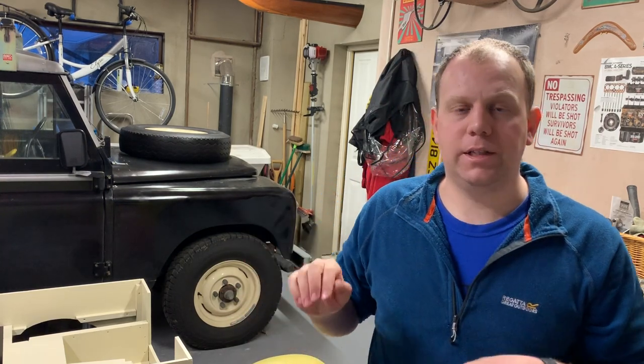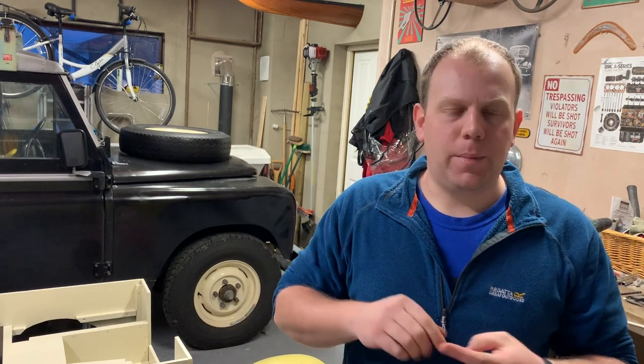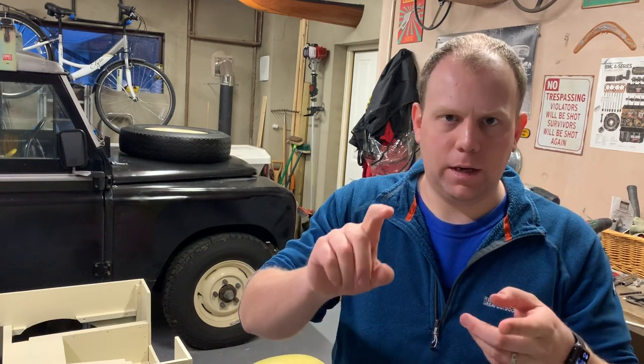The thumbnail in the last Toylander update probably gave you a bit of a hint as to what we've been doing, and we've made great progress on the lacquering of the bodywork. A lot of time has been spent preparing the bodywork for paint, undercoating it, PVA glue sealing it, obviously not in that order, and then colour coding it. So we finally got on with the lacquer.